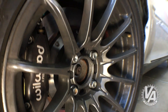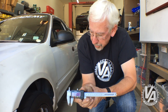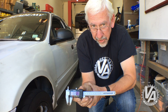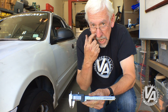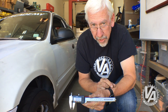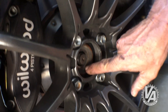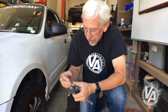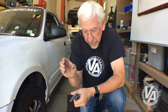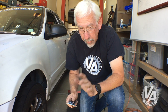Our axle is about 0.2 inches protruding from the center — that's actually within our ideal range. We want to make sure it doesn't protrude any more than a quarter inch, and isn't recessed any more than a quarter inch. When we did the measuring, we measured to the end of the stub all the way down to the surface where the nut typically bolts on. That's the critical dimension. If it's too long, you're going to find the bellows too compressed; if it's too short, the axle bearing is going to be too close to the edge. We don't want either of those situations.